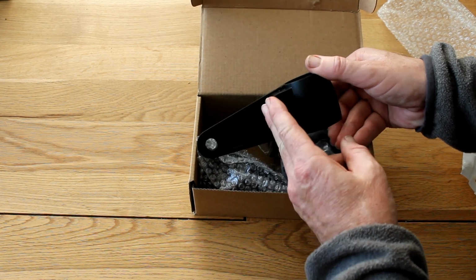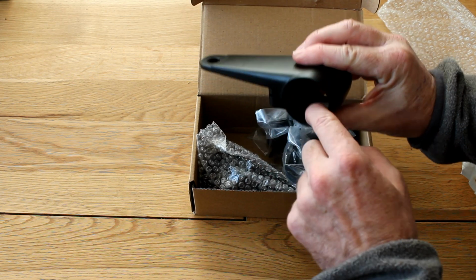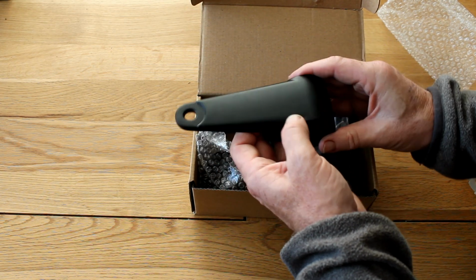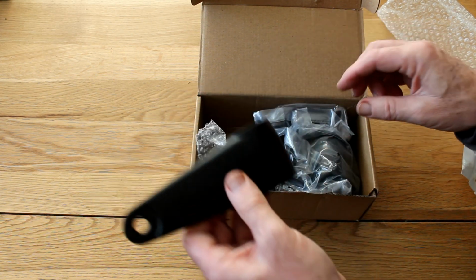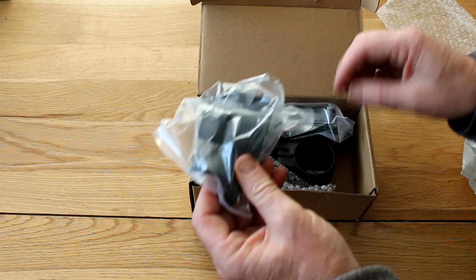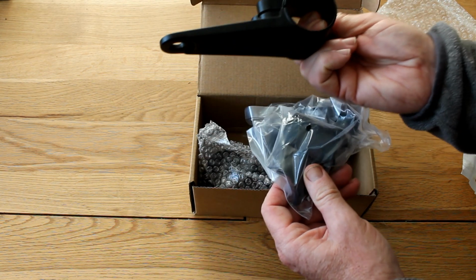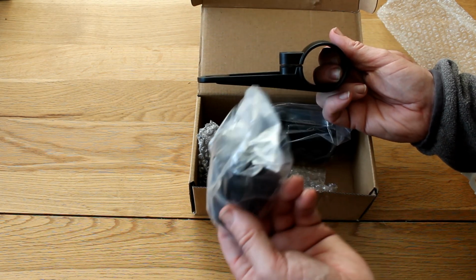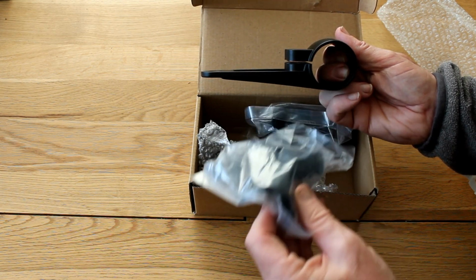At first I thought they were anodised, but I don't think so, because you can see the overspray here on the inside. So I think that's just cheap paint, and that'll come off quite easily if I wanted to remove that black finish. It also comes complete with these plastic spacers, because these are made initially for a 41mm fork like I've got, but if you include spacers you can fit it to a 40 or a 39 or even I think a 38mm fork.